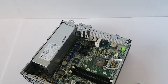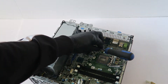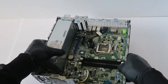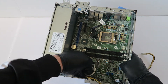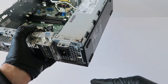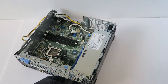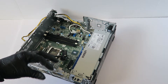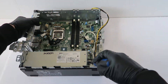I'm going to go ahead and remove the processor. On the back side, remove the power supply — there are a total of three screws you have to remove. There's a secure clip — press it down right here, the blue one — and it slides to the right.